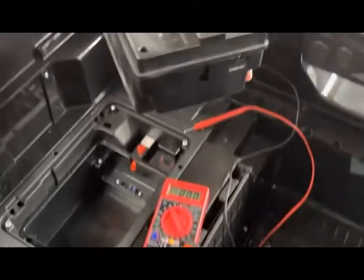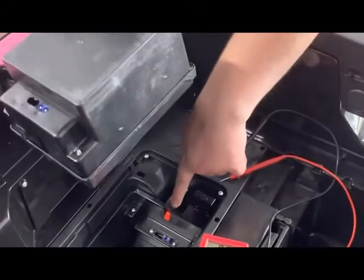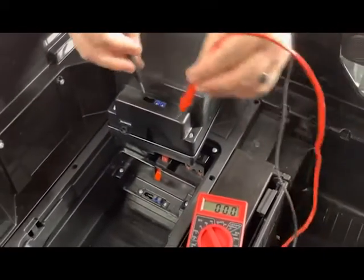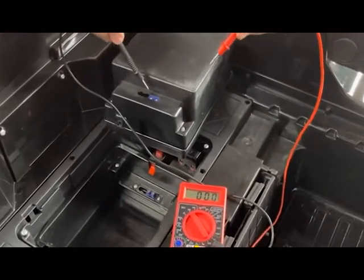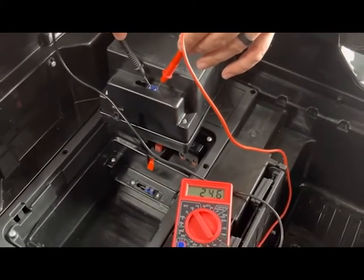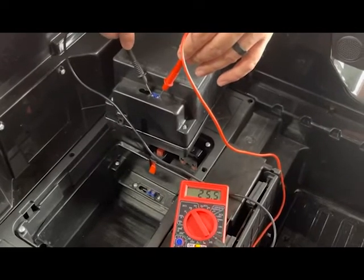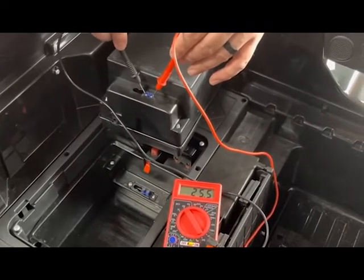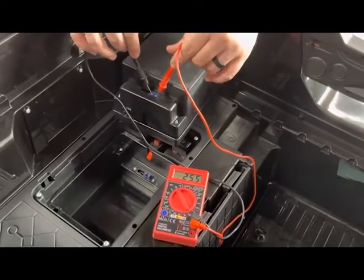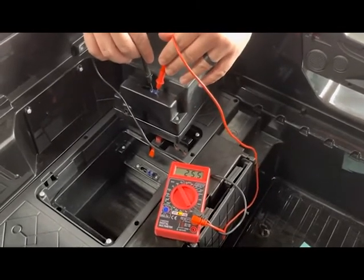The next thing we have to test is the actual battery pack. Turn it on its side and you'll see those blue plugs. Touch one probe to the gold ring and the other to the second contact — our pack is showing 25.5 volts, so the pack is looking good. Now, once you power it on and try to drive it, if the batteries aren't holding that charge anymore then that 25 volts can drop while you're using it. So if your charger and charging port are testing fine but your batteries aren't lasting very long, most likely the batteries have just lost their juice and need to be replaced.